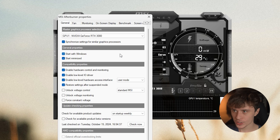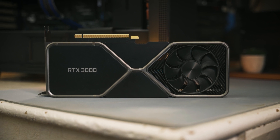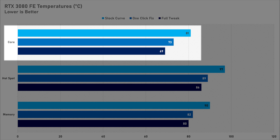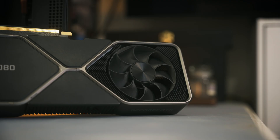Another tip: I like to adjust the fan curve to be slightly more aggressive. I've set it to ramp up more, but with my RTX 3080 we didn't really see that much of a difference. The core only went down by 4°C, though it did get into the 60s from the 70s. The hotspot went down by three degrees and memory by two, so it's not a make-or-break feature. The one-click fix makes the biggest difference compared to stock — if you don't want to bother with undervolting, the one-click fix is the sweet spot.